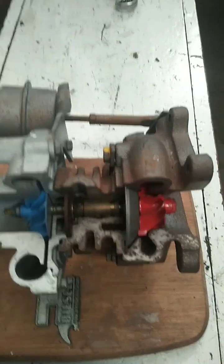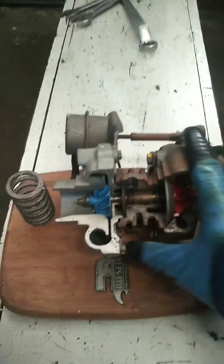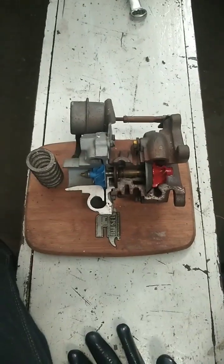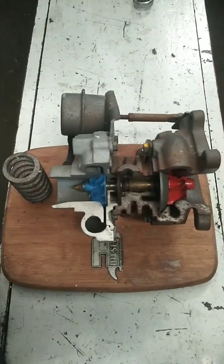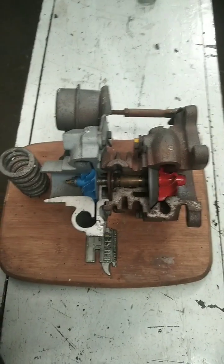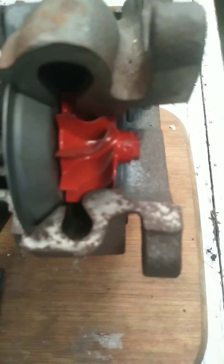So as you can see, they all turn along because they are driven on the same shaft. And up here, there's a part where oil drifts down to lubricate the shaft and the running components. And the oil drops down there. So there is an oil supply and the oil return. When the return isn't working effectively, you pay a price. Don't forget, some designers have intercoolers in the system to cool down the compressed air before it gets into the combustion chamber.